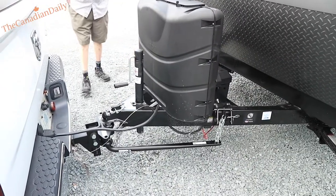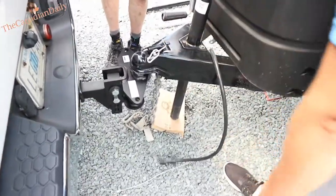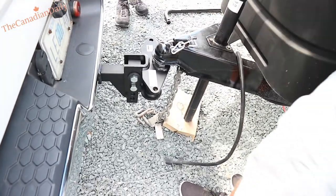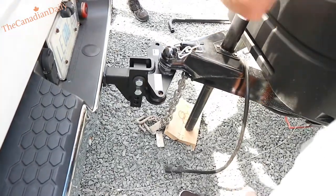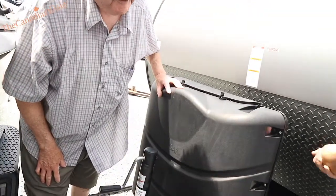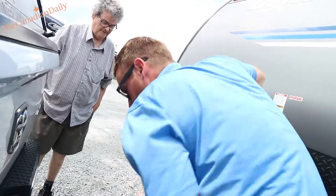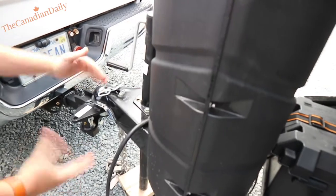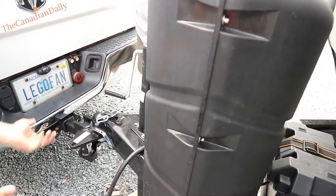Once you get this one on, you're perfectly safe and ready to do everything else. I want you to jack — lift the truck and the trailer at the same time. A lot of people will put these bars in with chains and they'll be straining — we don't have to do that. We do it the smart way. Bring a little six-by-six chunk of wood so the stroke of your jack will be a lot less.